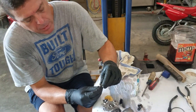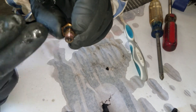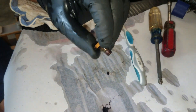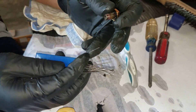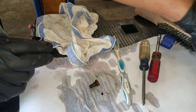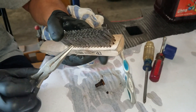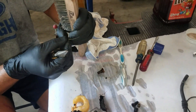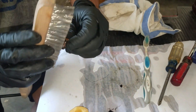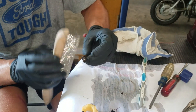This is a real important part here — this is the nut that goes into the bottom of the carburetor and holds the bowl on. What I'm going to do is take a wire brush and gently clean it, then use tip cleaners for an oxyfuel torch — just a torch cleaning set. Most people have a wire brush at home. These ports are very small, so take a wire brush and a pair of pliers, find a good straight bristle and pull it out. That's a real good wire to clean your carburetor with and to probe all the jets and holes. Or if you have a guitar string, something like that works too.